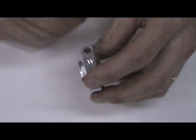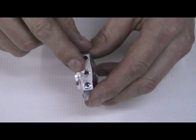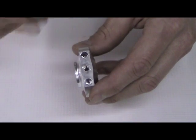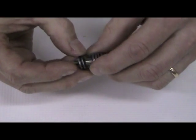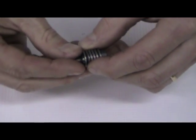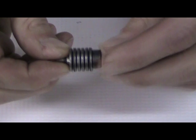On the arbor itself, where the bolt screws into, if it's over-tightened or not torqued properly, we can change our spring pressure. And last but not least, we can have a dirty spring stack — dirt getting in between the springs causing them to stack or pile up, increasing pressure.